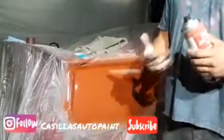All right, guys, we're back to this Charger. Last time you saw it, it was primered gray. I use that gray primer for one reason. I use DuPont primer because it's really thick. You mix it, it's supposed to be 4 to 1, but I actually mix it 4 to a half, so it's a half of one.